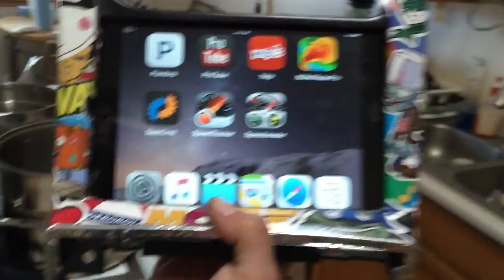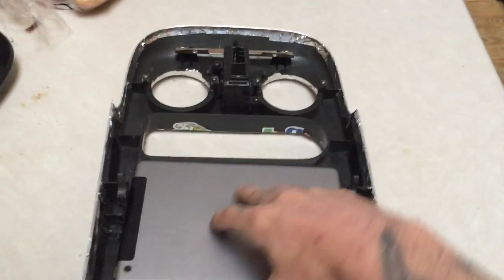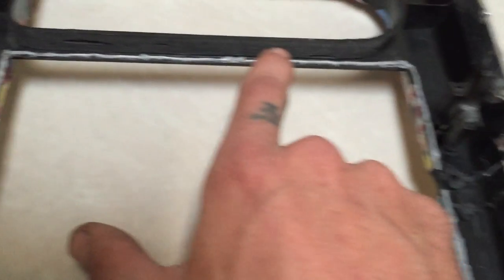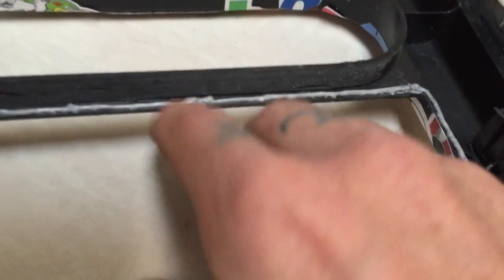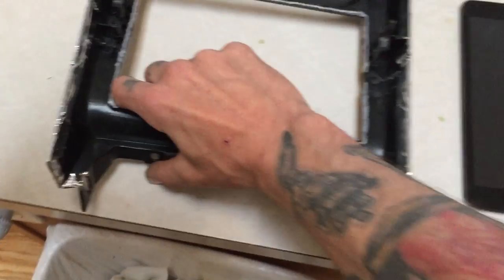This is what you end up with in your dash. Once I got the major cuts with the cutting wheel, I went in with the Dremel and smoothed everything as smooth as possible so there wouldn't be any air gaps or light gaps trapping dust or dirt. I also didn't want the plastic to cut into the screen protector, so I took some silicone gasket maker and put the tiniest little bead all the way around — about the thickness of an O-ring — and let it set up all night. Now it's like hard rubber, so the iPad snaps to the O-ring and seals up tight.